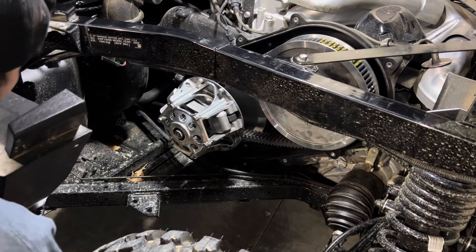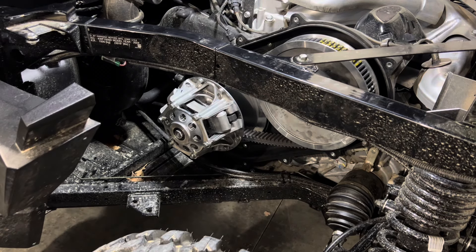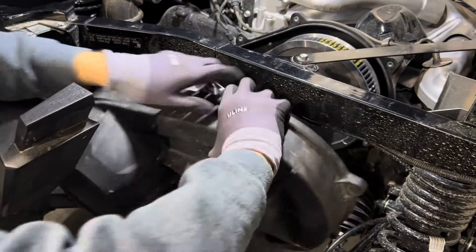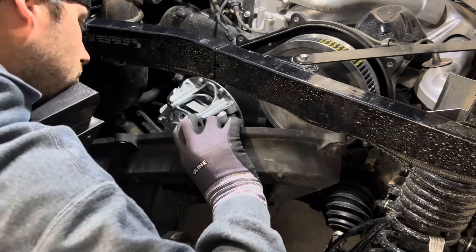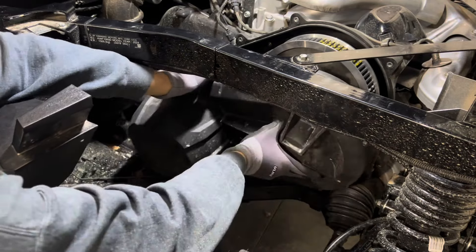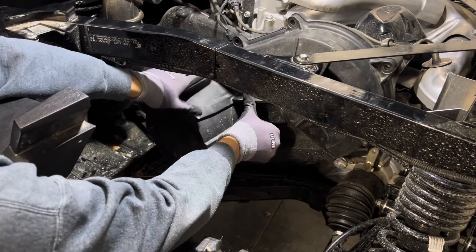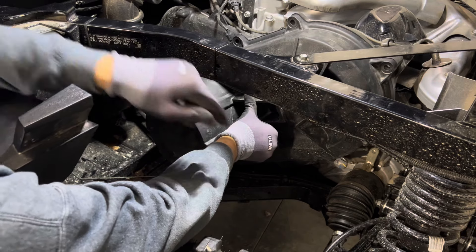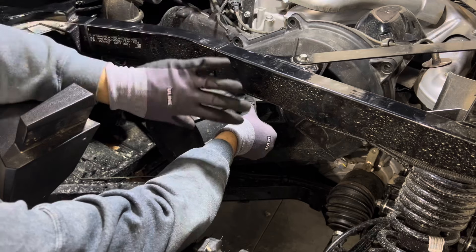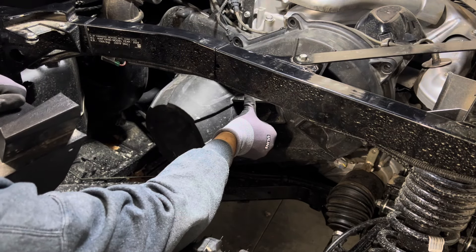That's really a wrap because putting your clutch cover back on is extremely easy. Just grab it and thread it into the wheel well. Make sure you have a gasket on the inside and that your gasket is in good shape. If you want to go test, just put four bolts in randomly and go test. When you're done, put the rest of your bolts in first, then put your access panel back on and you'll be ready to ride.